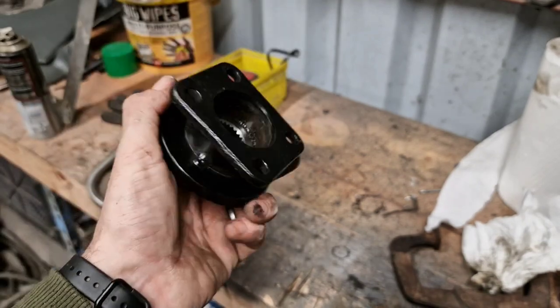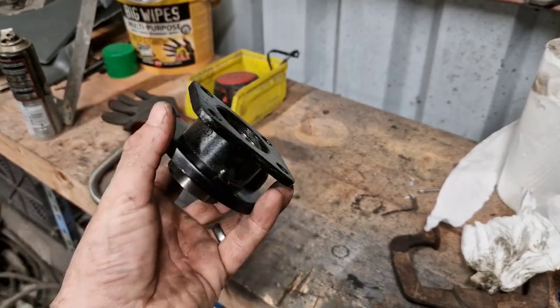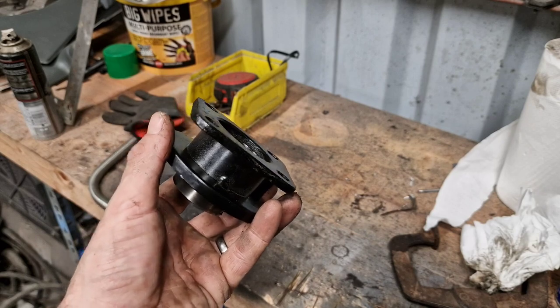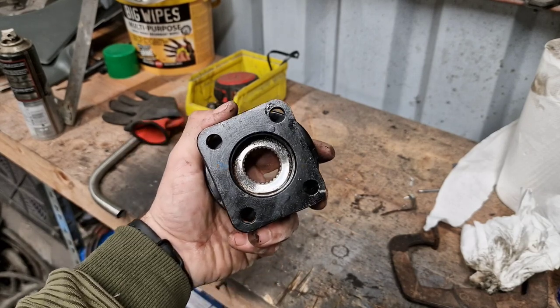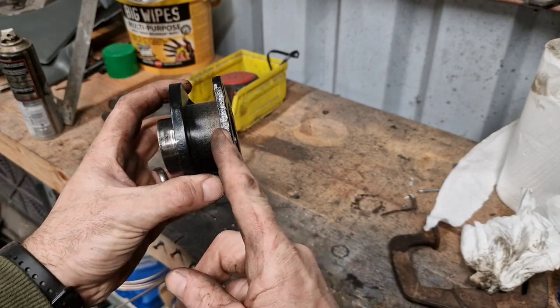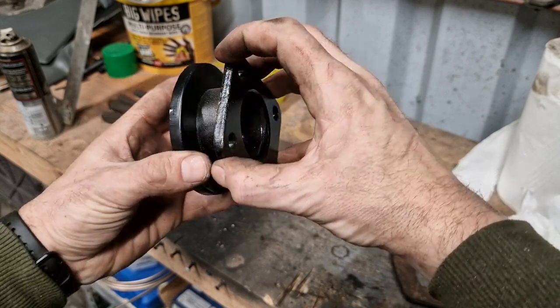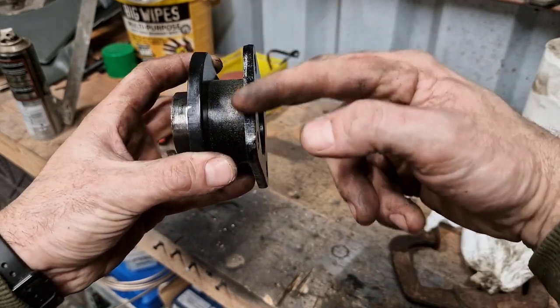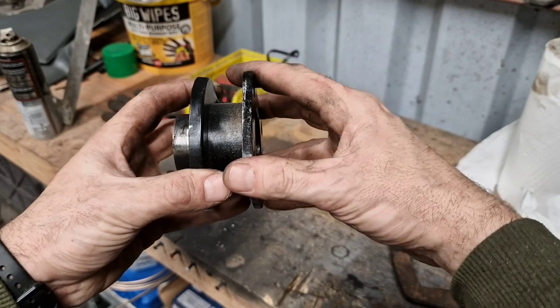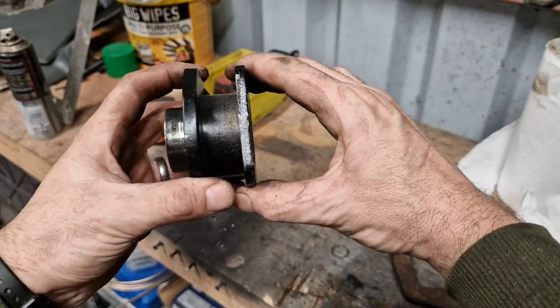So I think we'll start by marking out a plate. It's after hours on a Friday night and I don't have any steel, so I'm just going to cut a bit out of an RSJ I have in the yard. The real strength of this comes from the fact that it's all going to be in line with this flange here — the 6mm plate — so whatever torque gets transferred will go directly in line with the current plate, so a 6mm plate directly in line should see no problem.